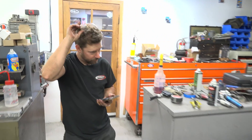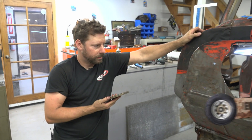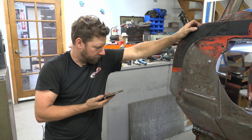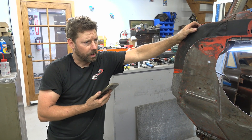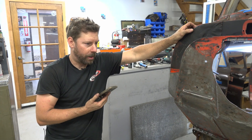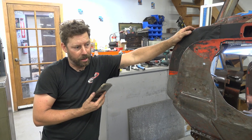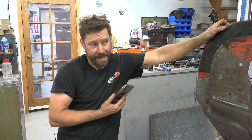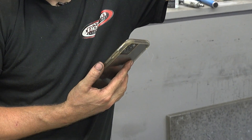What do you got? Well, I know you said you were going to start with the rockers and the floor, and I'm sure you're working on that right now. We were curious what your plan of attack was. Rockers and floor are going to be done tomorrow morning. And then I'm going to make a cardboard pattern for the firewall, get the sheet metal laid onto the firewall, then do the transmission tunnel and then driveline tunnel — because that's pretty much all I can do until we get more stuff on the front end so I can do the engine bay. Thanks, Sean. See ya.